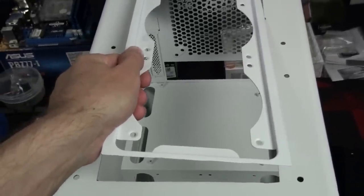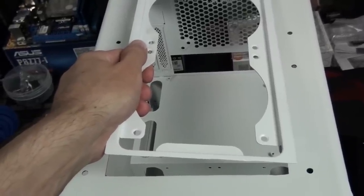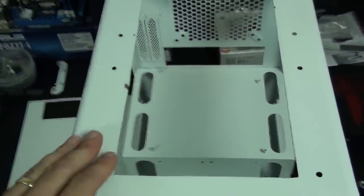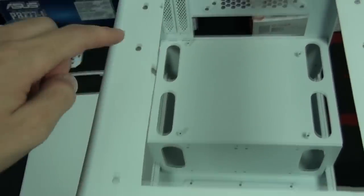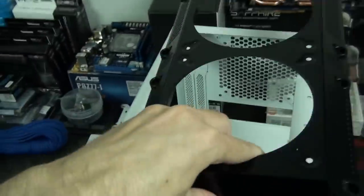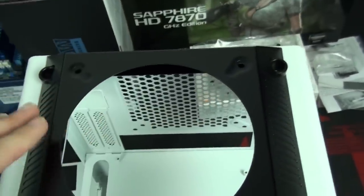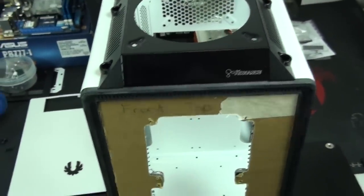There is the original panel from the top of the case for a 240mm radiator that this case can fit by default in the roof. All I did was go around the outside of that cutout and cut it out larger, then traced around the inside of the shroud and drilled 8 holes to mount it. The fans go inside the shroud and the radiator fits below it. A 280mm shroud actually fits on top of this case perfectly — within a millimeter.